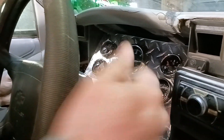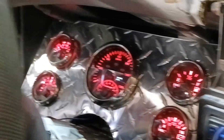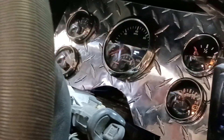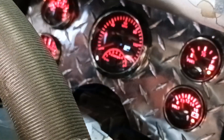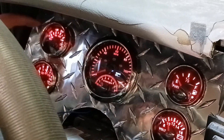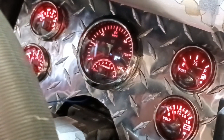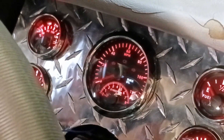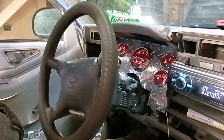I just went and changed out my battery — it's one that's less dead. You can turn these up and down right here. It's telling me my voltage is low because I'm not tied in with the sensor. My fuel gauge sensor is not in, my oil pressure says it's low because it's not running, and the temperature says it's low because I don't have it hooked up either. I've got to wire all these in individually. This has a GPS antenna that goes to it, so I'm wondering if I plug that in it'll see GPS — probably not in my shop, but once I get it outside it should read. I kind of like it though — it's going to look really good once I get it all pushed into the dash and everything hooked up.